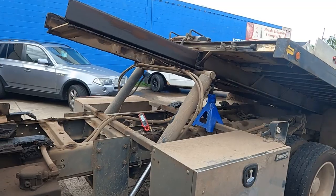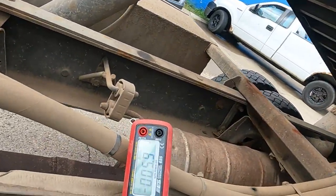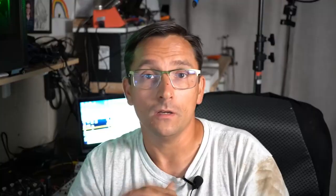Fuel pressure was within spec — I think it's 50 to 60 PSI per AllData. When I hit the release on my fuel pressure gauge, I got just a tiny dribble out and the pressure dropped fast. It wouldn't happen all the time. Nice thing about working on a tow truck is easy access. I'm showing about 5.9 amps on the fuel pump. I'm calling the fuel pump on this one. I didn't have my Pico scope or amp clamp today, so I just had the U-scope.